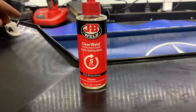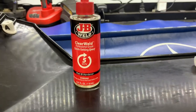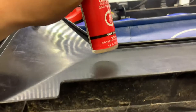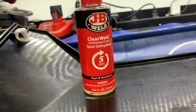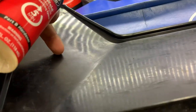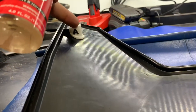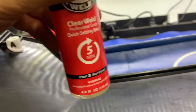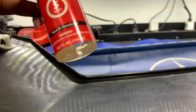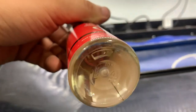What I use is a 3,900 PSI JB Weld Clear Weld. I use this because it's clear, which allows me to add a colored pigment into the resin in order to match the color of the door pocket. We're leaving these white right now because it's easier for anybody with a gray or tan door pocket to add pigment to their epoxy so the color matches a little better.